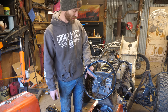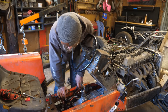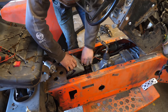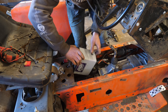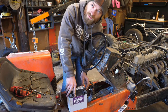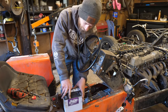Eventually we'll have to wire up to the ECU and program it to turn these lights on if oil pressure goes low or if it gets hot. We tried fitting a single battery in here, but one big enough to have the cranking amps wasn't small enough to fit in the space. So we got two power sports batteries — the kind for an ATV or motorcycle — and they're each 325 cranking amps. Combined that's 650, which is more than stock for this engine.